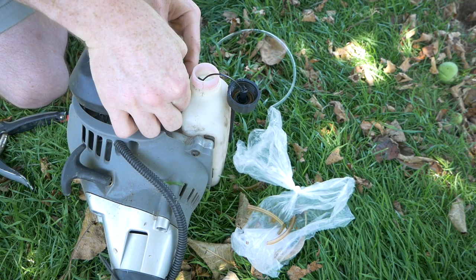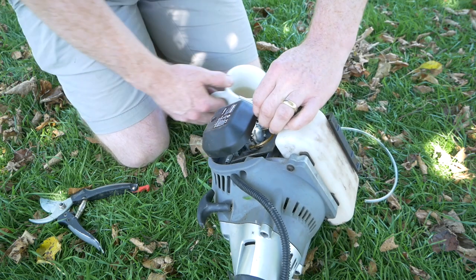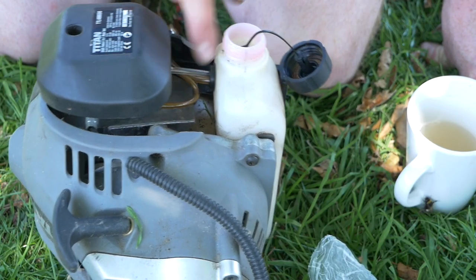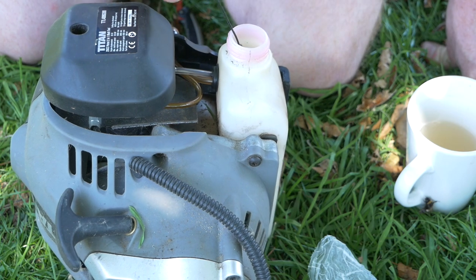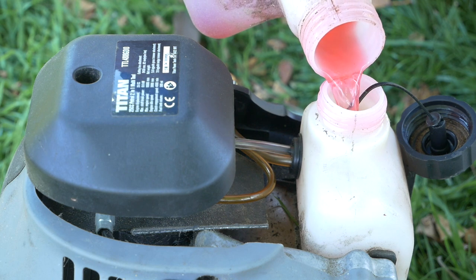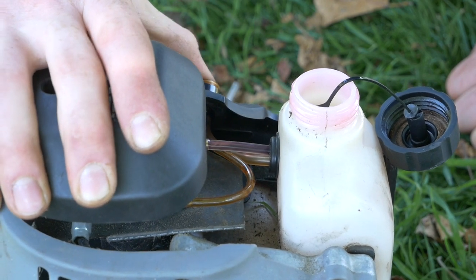Now is it going to fit over there? All right, it's proving pretty hard to get on that last bit, so a bit of boiling water or hot water, so hopefully soften off that hose if I can get some slack on it. I believe we've done it. We've replaced what was perished at least. That's all fine, that's all fine. So we just need to top up with some clean fuel and see if it all works. We've got fuel to here. There we go. Coming back down.